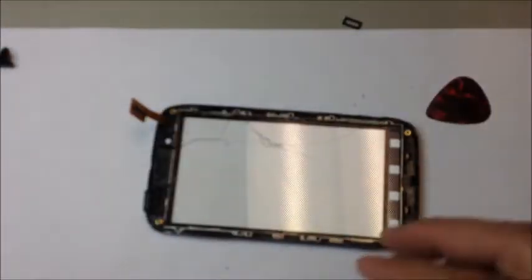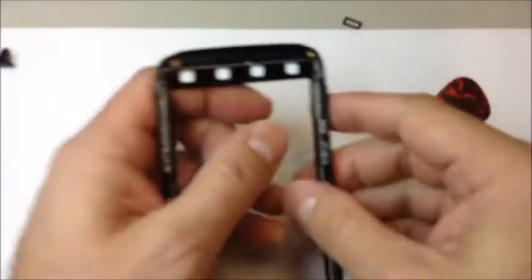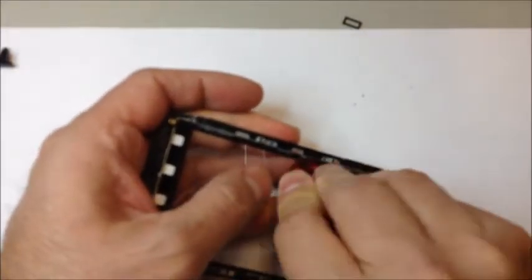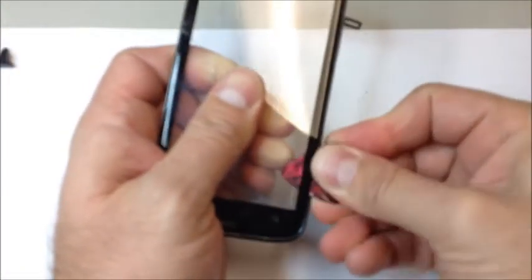Take a look at the new lens to see how it sits. The little white squares on the inside are going to remain in place — they help diffuse the light for the home button, search button, back button, and settings button on the front of the phone. Those white squares are now visible on the left-hand side. Start prying along the edge of the lens — the only area to be careful about is that bottom half; everything else you won't need to worry about too much.